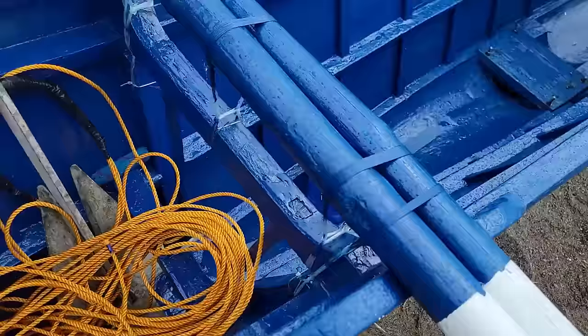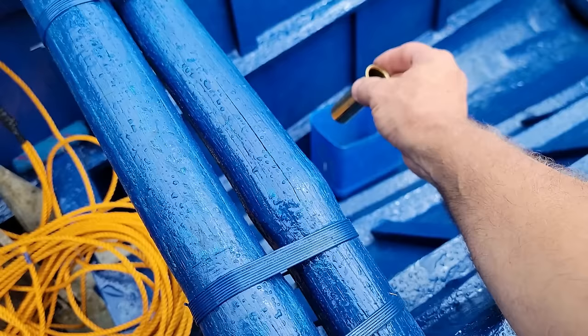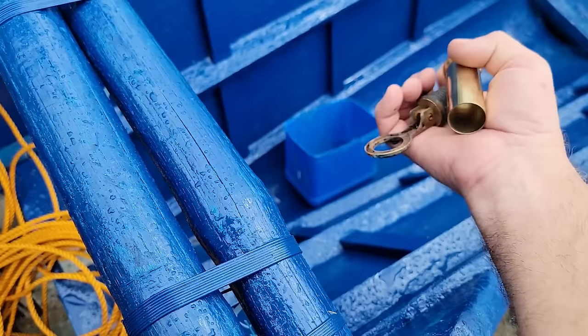Yeah, so if we can make that hole there bigger. Is that plastic in there now? Yes. PVC? Yes. So maybe when you take that out, the hole's almost the same then. So let's see if we can remove that, and then we'll epoxy this in with marine epoxy and put it through, okay? And then this here goes in from the top.